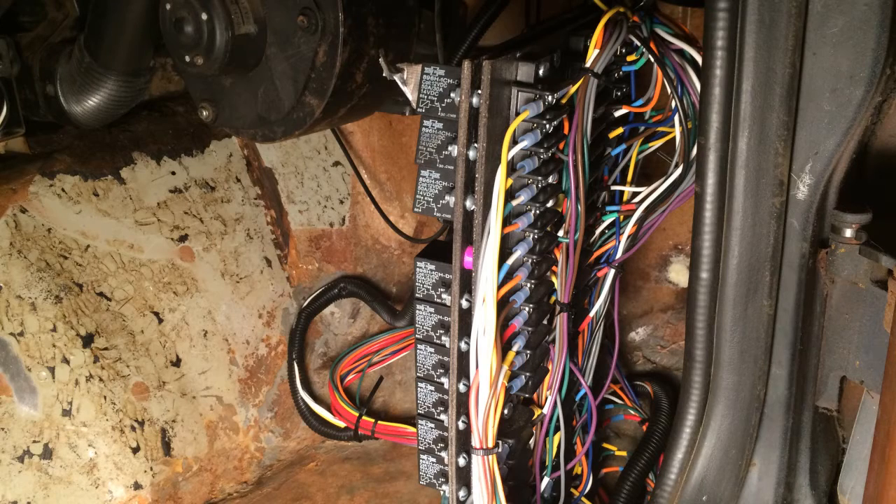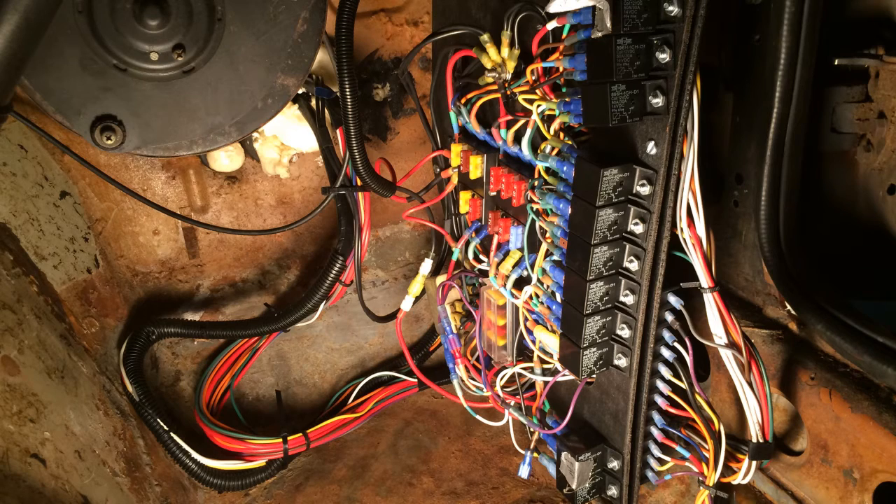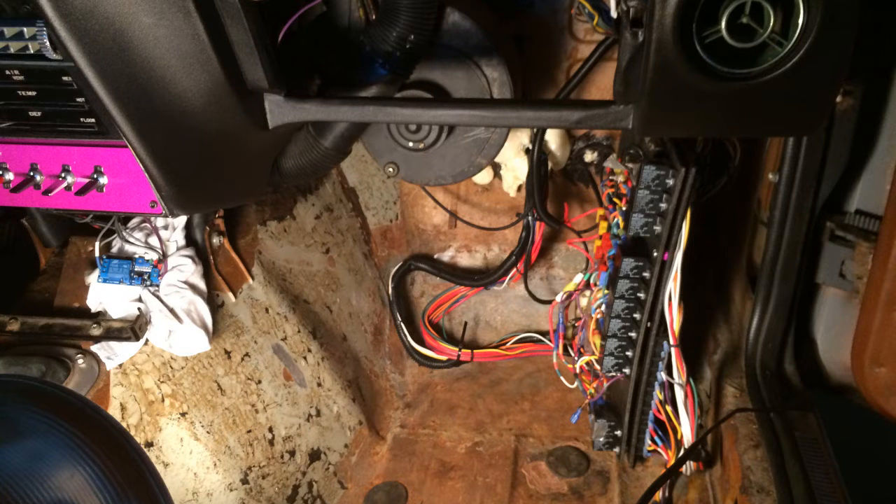Finally, after hours and hours of painstakingly doing every wire on that Datsun, this weekend I put in 15-20 hours and finished rewiring everything, and I have the wiring diagram done. What I have to do now is just print everything out on a nice big 36x48 architecture paper and double check the wires. The wiring on the car itself is finished — I have the terminal board completely together, everything functioning as it should, and it feels great to have that done.